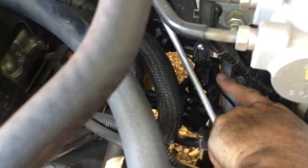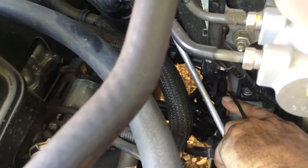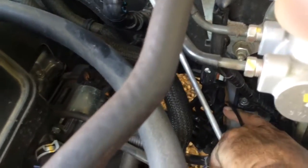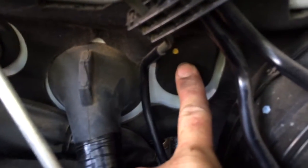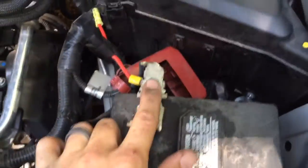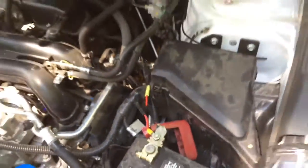They came up right down here next to the steering knuckle — you can see the yoke of the steering shaft right here, and the wire is right next to that. So every time you make turns with the steering wheel, that's an invitation for that wire to get tangled up in there. What we're going to do instead is come through this factory-provided grommet in the firewall and make our connection to the battery for the 12-volt auxiliary.